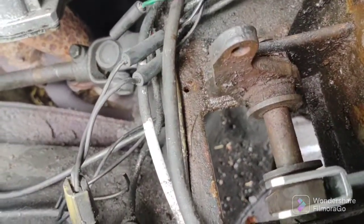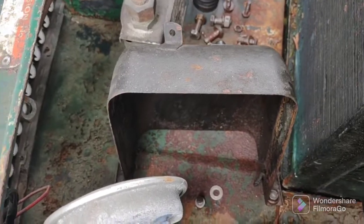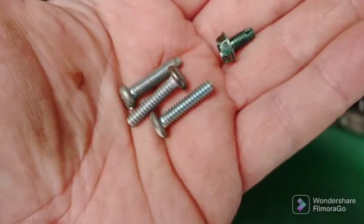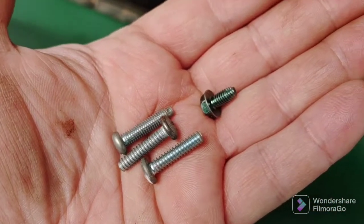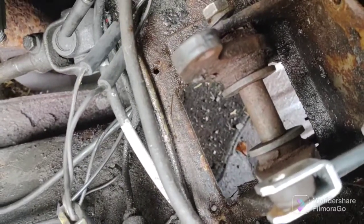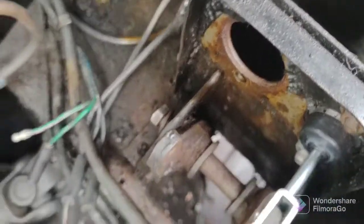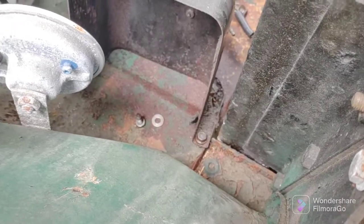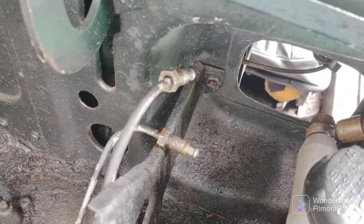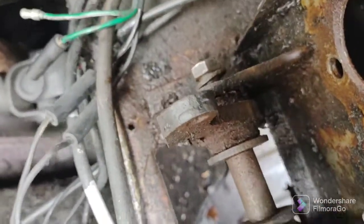I cleaned it a little bit and cleaned out those two front holes that the box screws into. The holes look like 10-32s, they could be 10-24s, or they could be metric. So I gathered an assortment of different screws - 10-32s, 10-24s, some others - and I'm going to lightly thread them into those two front holes for the cover. I'm also going to bring that bolt - the one that comes in from the driver's footwell through the firewall into the master cylinder bracket. I'm missing one on my car.